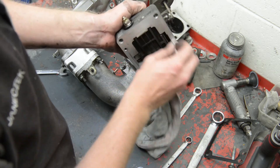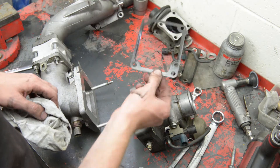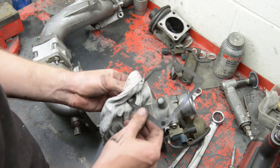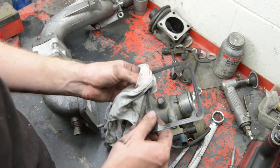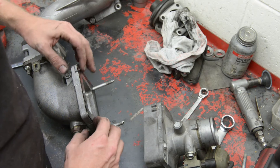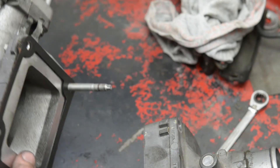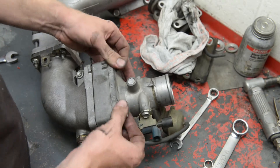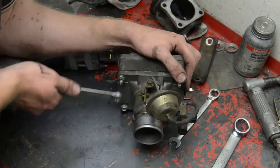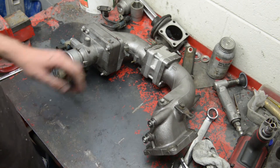Be careful, these edges are actually pretty sharp. There's your gasket — clean off that oil. Be very careful with the gasket — you don't want to push too hard as you can pull off the black coating. It's got a little tab; make sure the tab goes to the tab on the housing. So that's what the intake looks like when you put an EGR delete on.